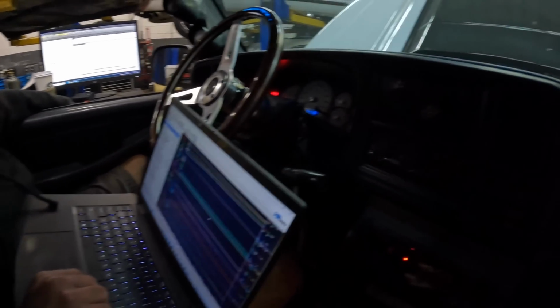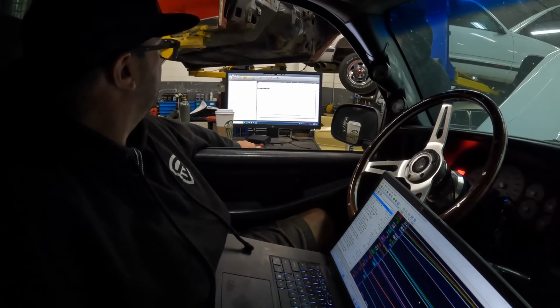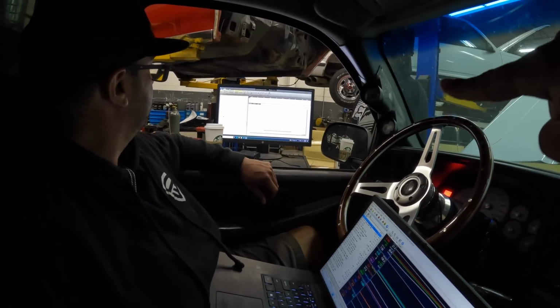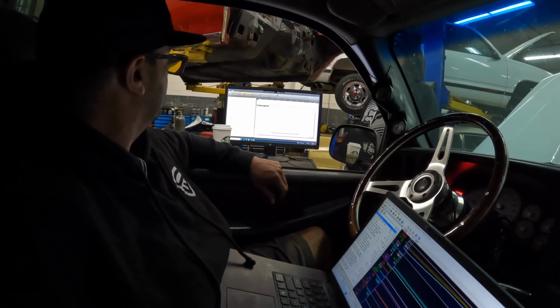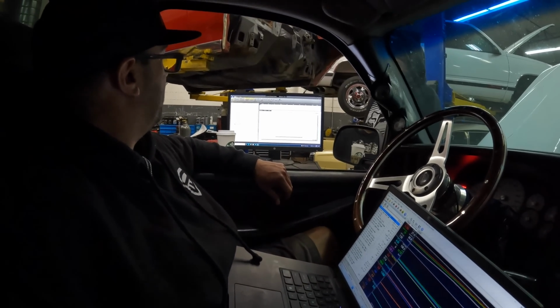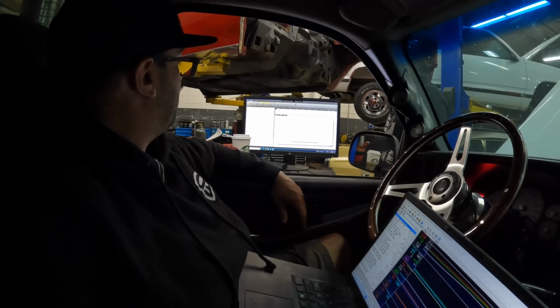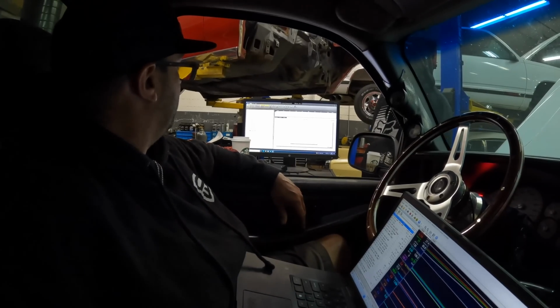All right, so me and Jay just did a little pull, and I can physically feel it too, what he was saying. So he was just showing me the graph. I'll show y'all after, but you can see about 4,700 climbing, then it just drops down, then starts coming back up as if the converter is locked, and it unlocks and then starts locking back up. Well, just like it unlocks and never locks back up, because it drops. That's a 60 horsepower drop from 47 to 48 hundred.